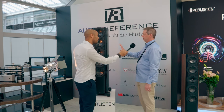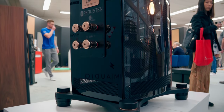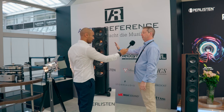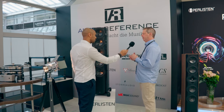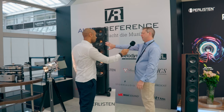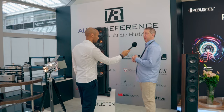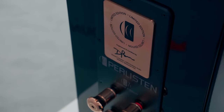And as you come to the side, you can see the carbon fiber panel. And that's over HDF, which is our cabinet manufacturing process. The carbon fiber allows us to do the beautiful arced side panels and increases the volume just a little bit. We get about a 7% increase in volume, slightly lower tuning, optimized for the new woofers. And you can't see it, but on the backside, we have special badging that's unique to the limited edition, and it signifies what it is.